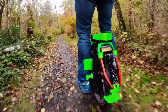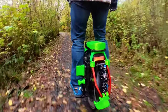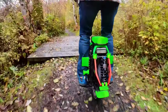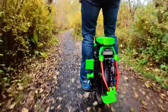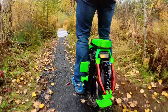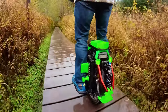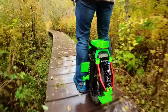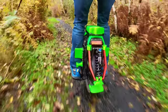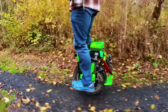I have the compression all the way to soft because I like a cushy ride, and the rebound is about eight clicks from fast. One thing to note with the sliders having this much freedom, you're relying on the coil obviously. This wheel, unlike my other wheels with coils, feels very springy. The Hero with a coil feels like a sponge to me — it absorbs all impacts, you slowly come back from it, very comfortable and not bouncy. This wheel hitting small stuff absorbs it quick and well now with the CNC sliders. But when you hit bigger stuff, you'll see me in the video bouncing a few times afterwards — that 'held up by a spring and not an air shock' effect. The difference between the stock sliders and these is quite impressive.